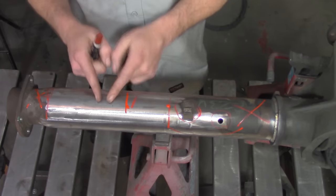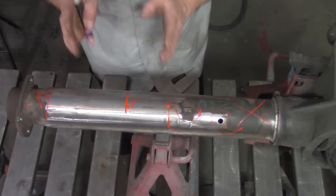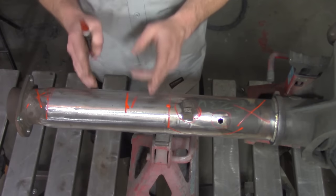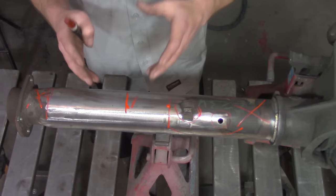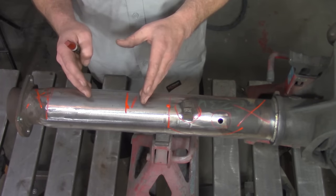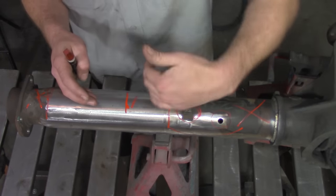You can actually place it between the U-bolts, or maybe on the outside or close to the inside of it, or somewhere in that general area. That's where you want it. In this case, this car is going to get a four link when we stuff it into the chassis that we're using it for, so we want to make sure that we don't have our welds and everything else landing right on that zone.